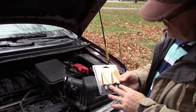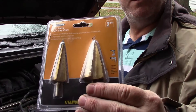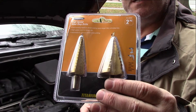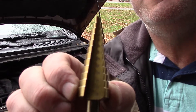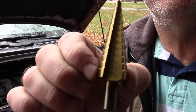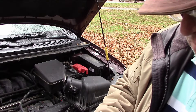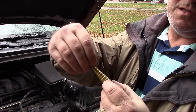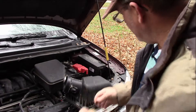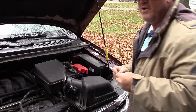What I have here is a high-speed steel step drill. I am going to use this because the measurement stated has to be 13 sixteenths of an inch. I will use this smaller one because they are all marked graduated with what the size is, and in this case it says 13 sixteenths — so we have to drill all the way up to this last step here. We are going to drill a hole through this air box cover and then once we get up to that point we can install it.